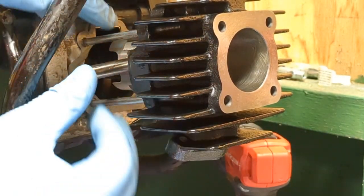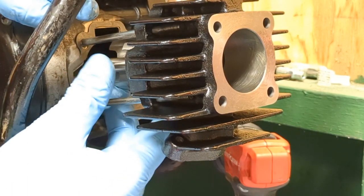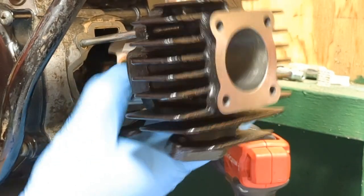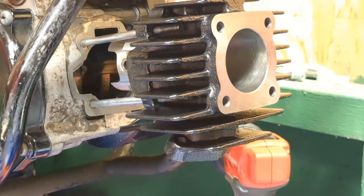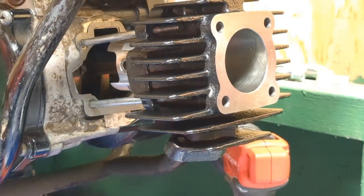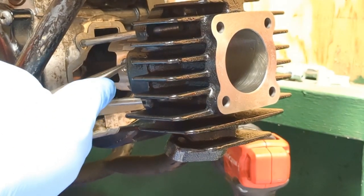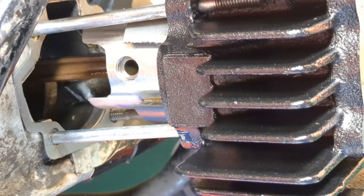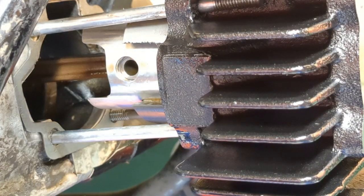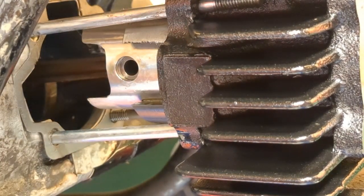Make sure you get that rod lined up there, and then just seat that pin all the way through that rod, and seat it all the way down with a screwdriver or a pair of pliers. Clean these pliers off. Seat it all the way down, and then take your other little clippy thing, and make sure you don't shoot these to the moon, because they will. If you let them, they'll shoot to the moon.